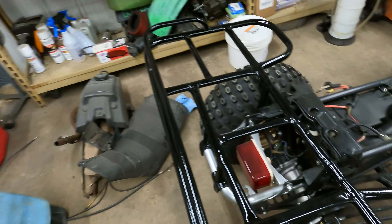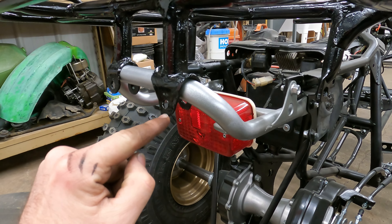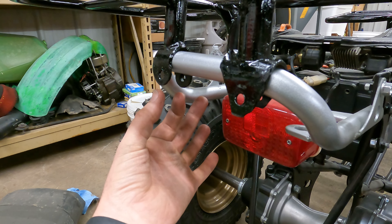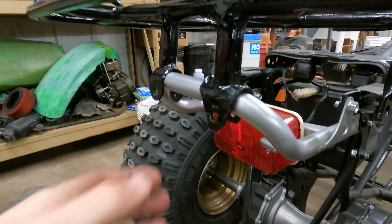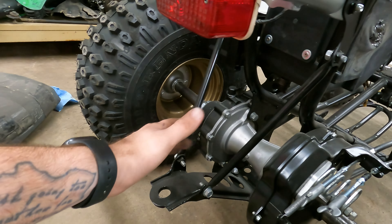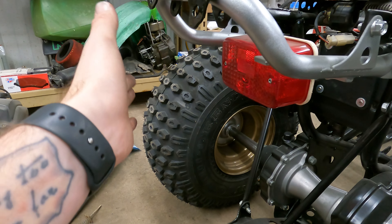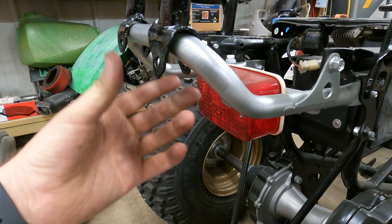The paint's dry on these — I'm super happy with how it turned out. Now down here where the bolts go, there's supposed to be a spacer that goes in here so that when you tighten this down, they don't just collapse on each other as tight as they can get. We need to build some sort of spacer there. We're going to use the same piece of pipe that we used to make the supports for the rear hitch and cut those into little sections to fit right here. I want to make them maybe just a touch smaller than this diameter here so that it can squeeze in a little bit.